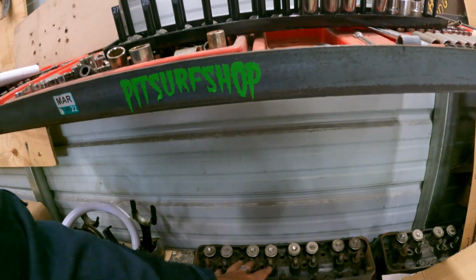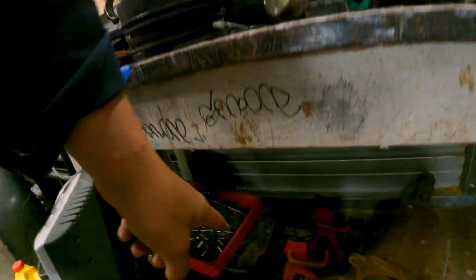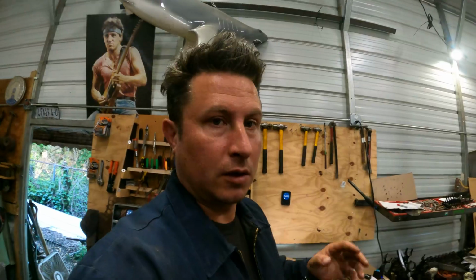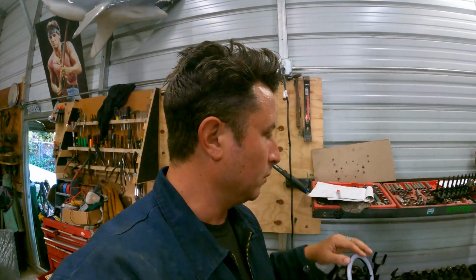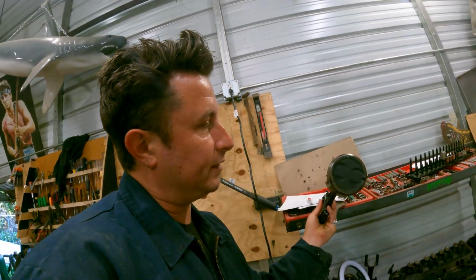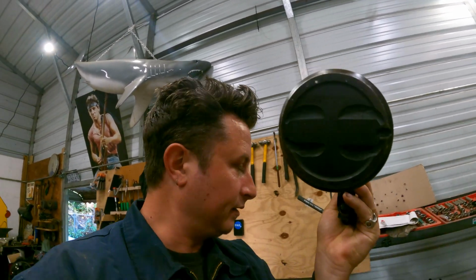But while Craigslisting, I stumbled on these 461 totally rebuilt heads that I picked up for 400 bucks with an aluminum 4-barrel intake that's hanging out under there. Thinking that's the deal of the century, I jumped right on it. We will get into this in great detail later, but my general mathematics of all of this is, with the 461 heads, the stock pistons that have, I believe, the 12cc dish. If somebody can tell me how to estimate what it is, that would be great, because then I can calculate the compression ratio even better. But I'm assuming those are 12cc dishes with the little eyebrows.